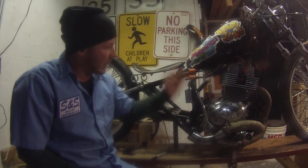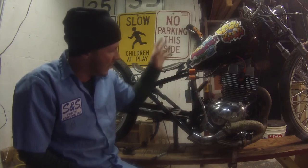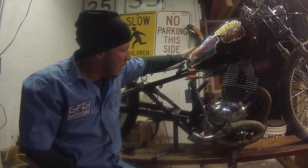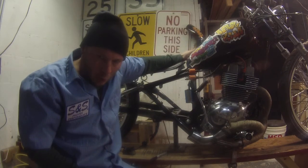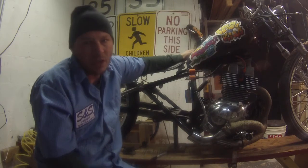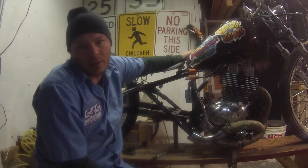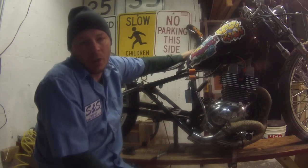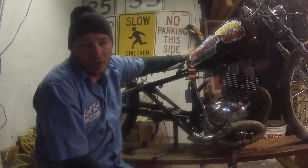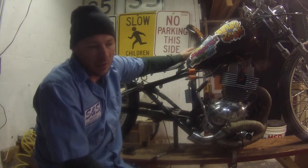So I got 2 carburetors coming. And I'm thinking about doing forced air on the other side. I'm not sure, because that's all out race, just go. And I want to tool around town. So it's going to run really rich. So I don't know if I want to do that or not, because that's basically wide open throttle. Anytime you mix forced air and fuel, you need more fuel to more air to even it out.